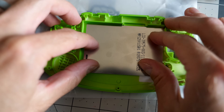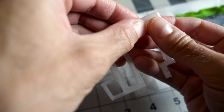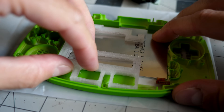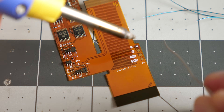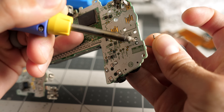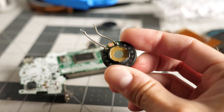Just set the screen into the upper right corner. I skipped installing the double-sided tape on the display because I was also sent these neat little 3D printed brackets to hold it in place. Not having that adhesive makes any future mods or repairs way easier. Next, I could solder a few wires to the display ribbon adapter cable for the brightness control. It's an optional step, so if you don't want to do any soldering, you can skip it. The default screen brightness is just fine in most cases, especially if you're indoors. Then I worked on the GBA's motherboard for a minute to install a clean amp module to make the console's speaker louder.